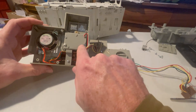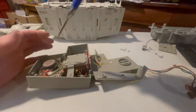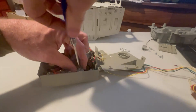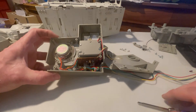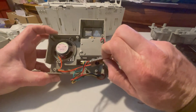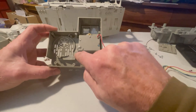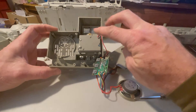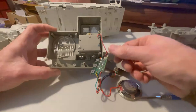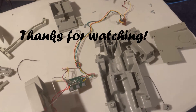You can see corrosion on this terminal as well. We're going to take these two screws out to loosen the speaker, and take this retainer out to take this board up and out. With those out of the way, we'll pull out this electronic module and pull this speaker out. Our next step is to desolder the red wire at the top and desolder this black wire at the bottom. All our parts are cleaned up, all the internal components are set, and we've got our electronics module working. We'll just begin the process of putting it back together.